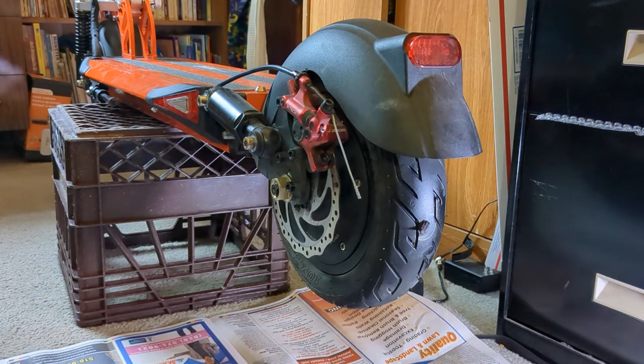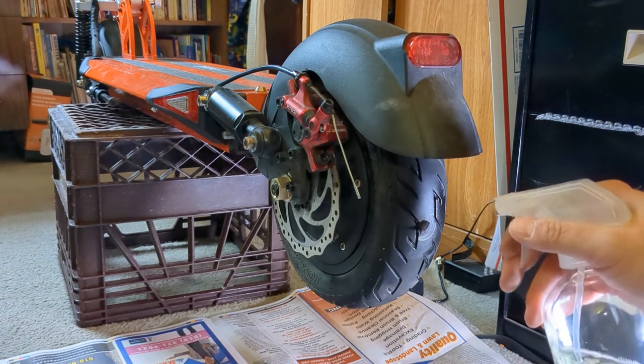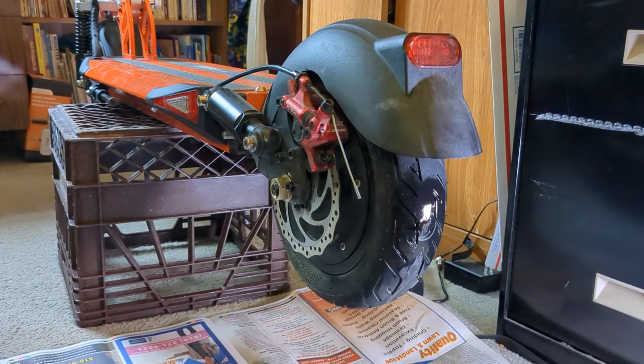Find our patch location, give it a spray, and there are no more air bubbles. Our tire has been successfully plugged. That's all there is to plugging the tire on your e-move cruiser. If you own a car, you can do the same thing — as long as it's not in the sidewall. I don't recommend doing this on the sidewall of your tire. My name is John from Ride Upstate. If you found this video helpful, give it a like, and if you want to see more content like this, please subscribe. Thanks, bye.